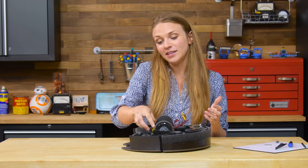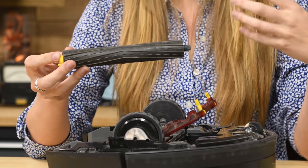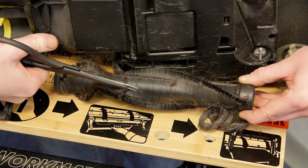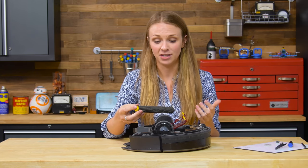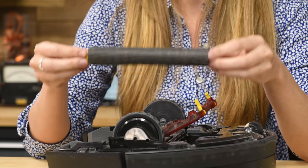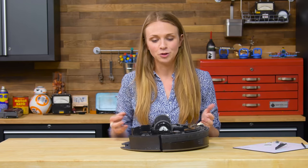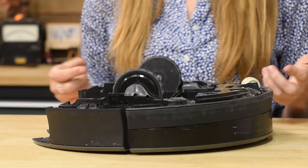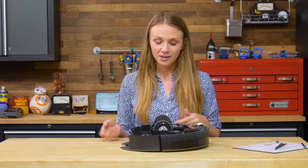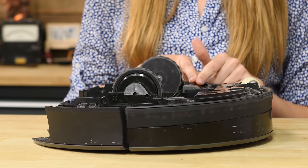These are the counter-rotating rubber treads that the Roomba uses to pick up dirt and put it into the vacuum. They're different from your standard vacuum, which uses rollers and brushes that end up getting tangled in rugs and have a hard time going over different types of flooring. These rubber treads are much less accident-prone and will function a lot better when cleaning up your house. The Roomba moves itself around with two rubber wheels independently operated by their own electric motors. The harder the motors have to work, the shorter the battery life, so you want to make sure you get in here and clean out any hair or debris that's causing the motor to work harder.